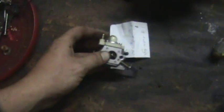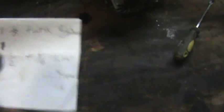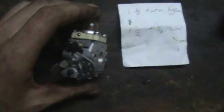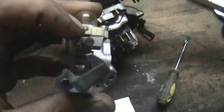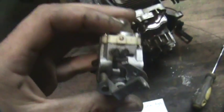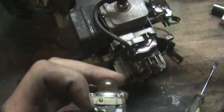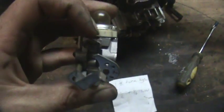A prime bulb — you don't really need it so much, but just make sure that it is one that recycles. A lot of the fuel can dump through and come through, and it can take what it wants. One and an eighth turns from a comfortable zero on the high, and one and a half plus a sixteenth on my low — that is what I adjust my carb to. When I say a comfortable zero, you are going to turn your screw all the way in clockwise until it is at a comfortable nothing. You don't want to over-crank it, just where it feels like it is there at nothing. Then back the high out one and an eighth turns, and back the low out one and a half plus about a sixteenth.